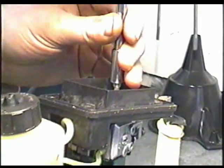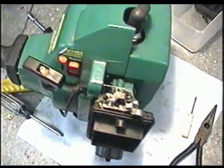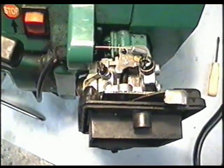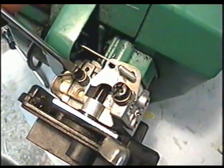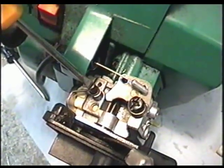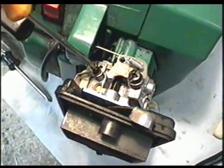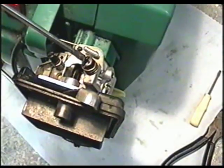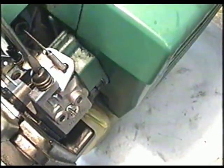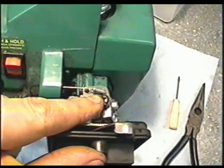Re-tighten the bolts. It's filled up and ready to be started to see how it runs. I'm going to be adjusting the carburetor — there's only one screw to adjust the running of the carburetor. If your motor runs too lean, you would unscrew it. If it runs too rich, you would screw it in slowly. I'm going to do this at full throttle and turn the screw until it runs at its best. The final adjustment will be the idle adjusting screw. When the motor runs good, I'll leave that screw and then adjust the idle one.